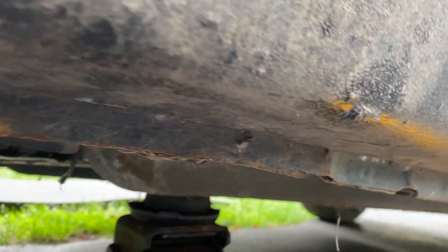The frame rails on this side have got a little bit of cave-in — you can see where it's been run over some speed bumps a little too quick. This side we've got a similar amount of frame rail damage. You'll notice that where I've jacked it up right here, it's at the end of the frame rail where it's reinforced, so I'm able to jack it up there without doing any damage. From there to the end it's like a double thickness, very sturdy — that's why we can jack it up there without caving in the frame rails. I'll also show you the drain holes, which is the reason why the rocker panels aren't rusted out yet. There's one there and another right there — somebody has taken the time to open those up so water can flow through easily, because that's the main reason we get rocker panel rust on these Miatas.